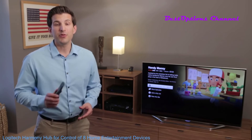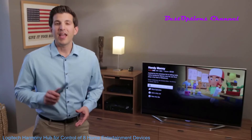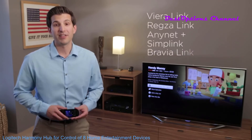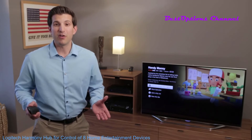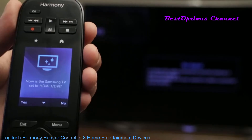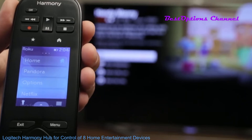For activities to work correctly, here are a few important tips. Avoid manually controlling individual devices or using your original remotes. Disable HDMI CEC features on your devices — HDMI CEC is known by various brand names such as AnyNet Plus, Simplink, or Bravia Link. And finally, ensure your remote remains pointed at your devices until the activity startup is complete. This can easily take over 10 seconds, and if your remote is pointed in the wrong direction, things can get out of sync. If any of your devices ever get out of sync, it's always best to use the On Remote Help feature rather than manually controlling the devices. Harmony will ask you some simple questions to get everything back in sync.